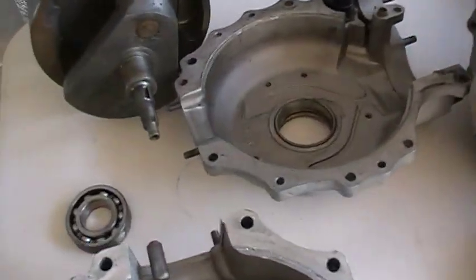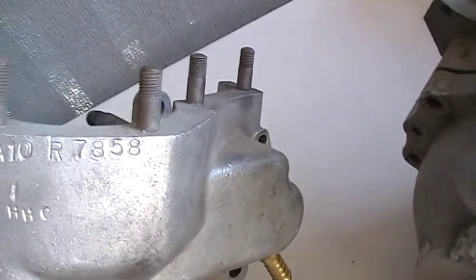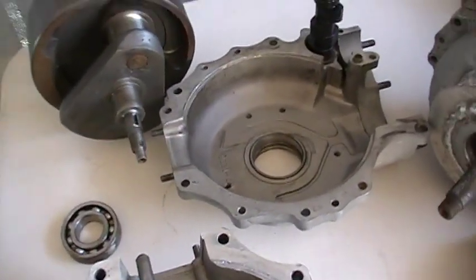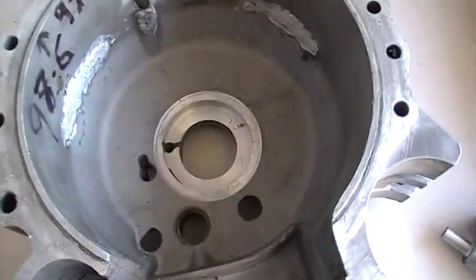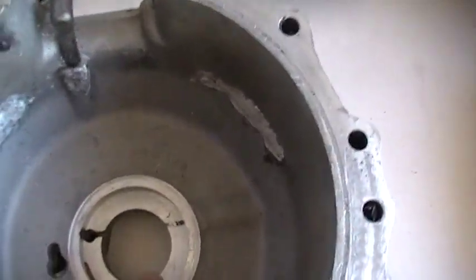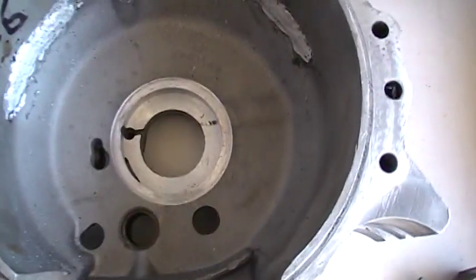But this is a little Spitty motor, as in the Spitfire, but the frame that I've got for it is pretty ordinary, so a lot of lugs cut off, so it's just going to be a little dirt bike. But I'd already started this roller bearing conversion some time ago. I don't use a needle roller on this side, I machine the case, put a steel top hat bush. It gets held back to the case by 3 screws.